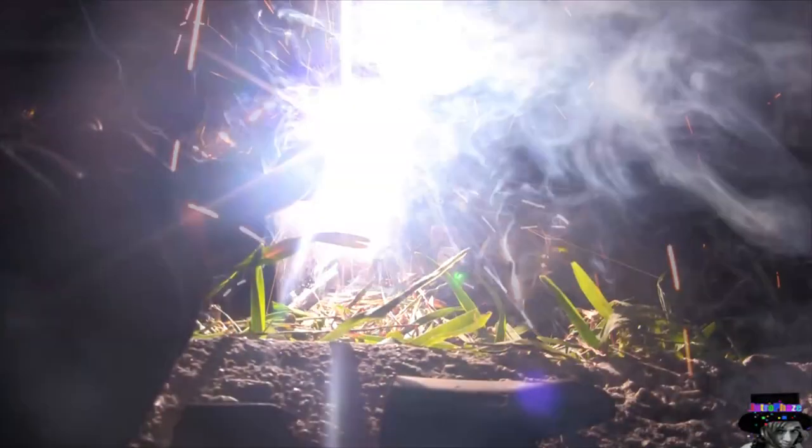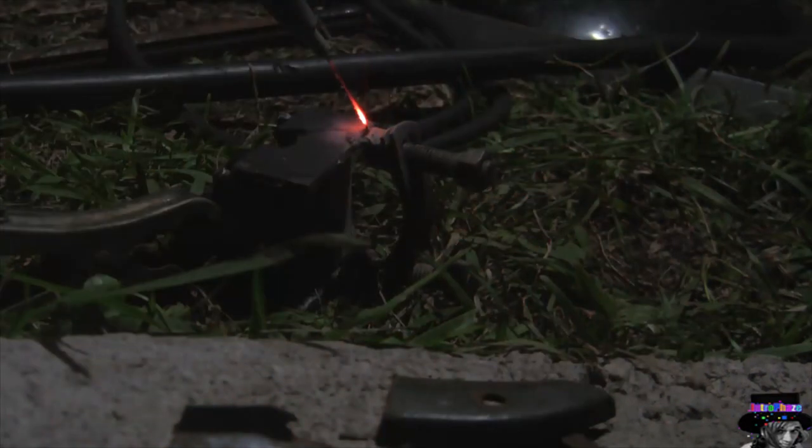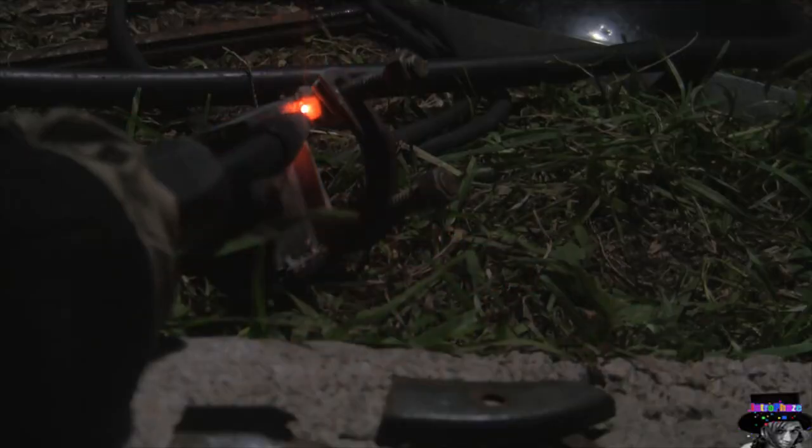To actually hold it onto the bike, I'm welding two bolts, and I've got a piece of steel with two holes drilled in it so I can screw it onto any pole on the bike — the stem, the middle of the bike, or basically anywhere. You put the bolts right through the holder in the middle and spin the nuts until it's super tight on the bike.